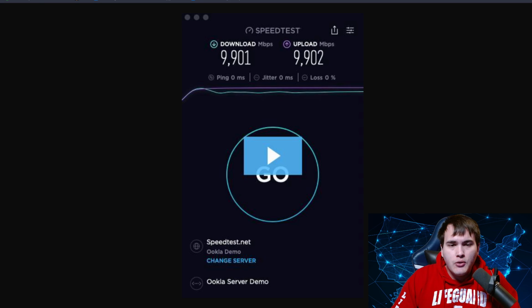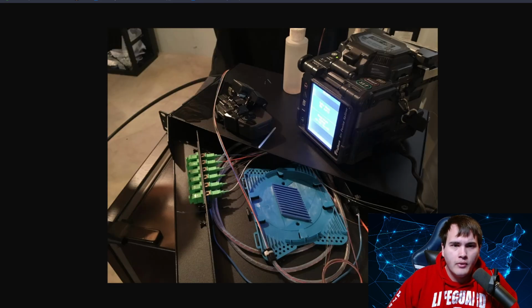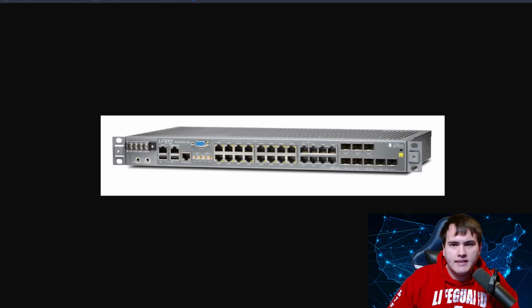Basically what it is, you have a dedicated wavelength service, what they call the Metro E network. It's a 10 gig port. You get 10 gigs, and then the router that they give you, which we will come back to, is the Juniper ACX 2100. It's 10 gigs to there. And then they changed the software in a very minuscule way to police it down to 6 gig.